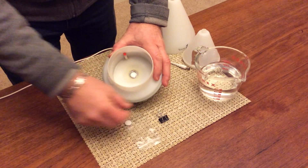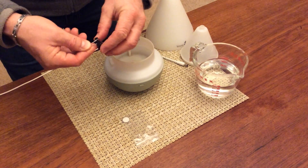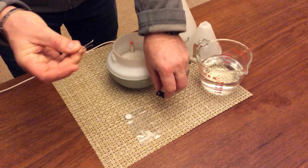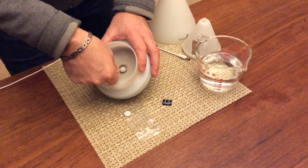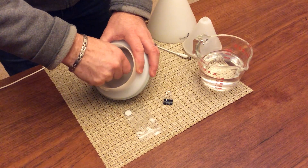A little trick to take out that ring is to use a small binder clip — just squeeze it together and take this part of the binder clip out. The two prongs that come out are a perfect tool to fit inside this ring to loosen it up and unscrew it.